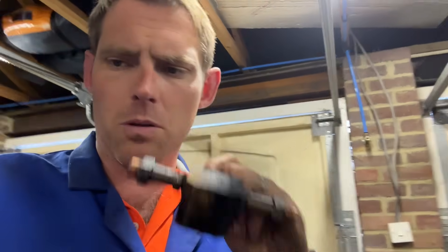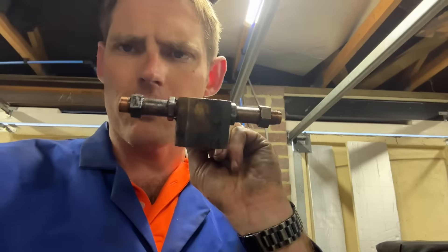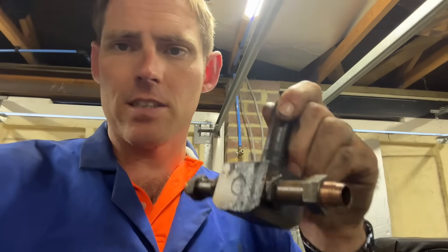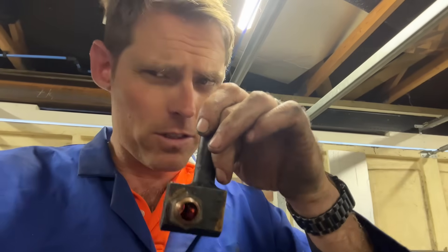As far as the exhaust is concerned, very similar affair — in between the two blocks again. If it was mine I'd probably be considering doing something differently, trying to get a swept exhaust to get rid of the sharp corners for the exhaust passages. As this one is, those two go together as a T that then turns 90 degrees to go into the block and then turns 90 degrees again to come out the top of the block. I think that could all be done a lot nicer, but that's not what I'm here to do.